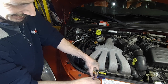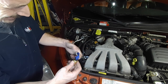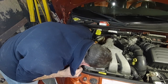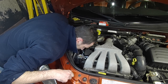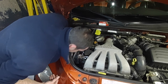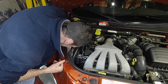It's going to be a little tricky getting it in there, so I'm going to put some tape in there to hold it more firmly. I've got it lined up and I just tried to get it started - I think I got it started. I want to make sure it's going in squarely. Got it a few more turns by hand here and then we'll switch to the ratchet. You do want to make sure you're not putting a lot of sideways pressure on the socket because it could break the plastic part of the sensor off.